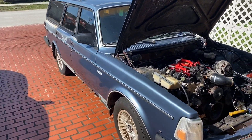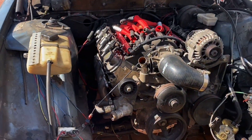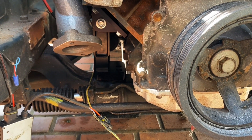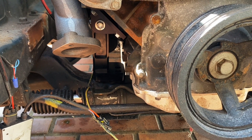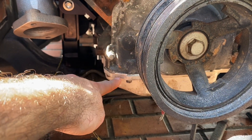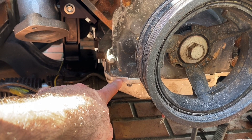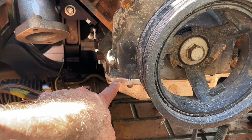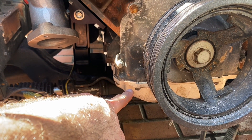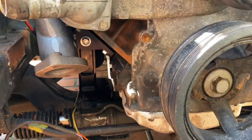There you can see the beautiful Volvo — the motor is actually mounted up. I'm using STS Machining billet swap mounts; you can see they fit in the factory place, absolutely beautiful. This is a Holley knockoff aftermarket oil pan — it's chinesium grade from eBay, much cheaper on there, and it comes with everything you need. You just have to trim the windage tray from the F-body because the pickup tube hits it. That's in there.